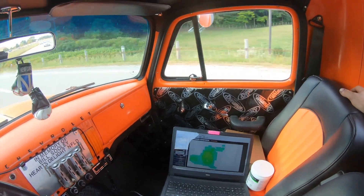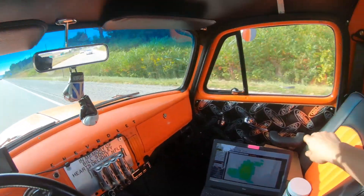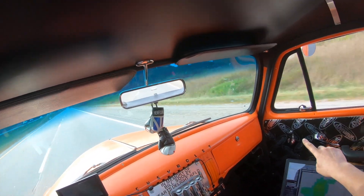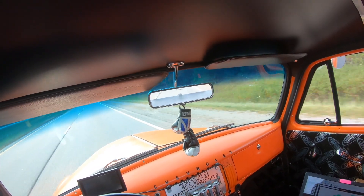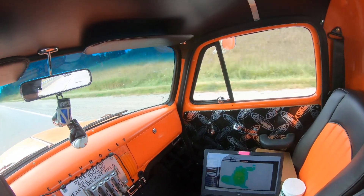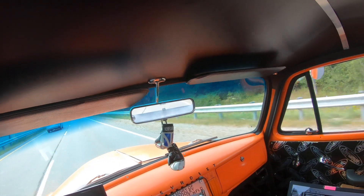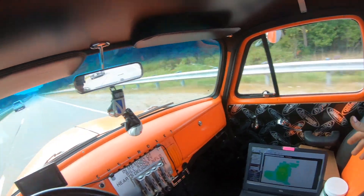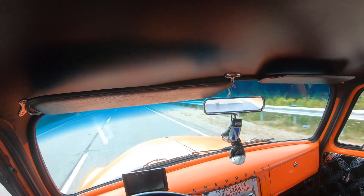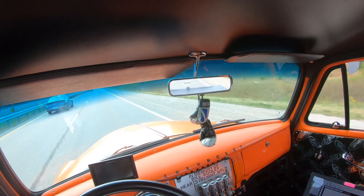As you can see right now, I have the laptop hooked up and I'm going for a spin, because that's what he was complaining of. Usually what it is, is a lower part of the fuel map that's too lean. So when the idle comes down, it hits that lean spot so fast and then it can't recover. I find if you just go in with a laptop — if you're thinking about installing a Sniper, or you already have installed a Sniper and you're having issues like this — your best bet is to find someone familiar with laptop tuning on a Sniper system or a Terminator system. Because the handheld tunes are almost like one step up from a carburetor, and on some engines they're not even that good.